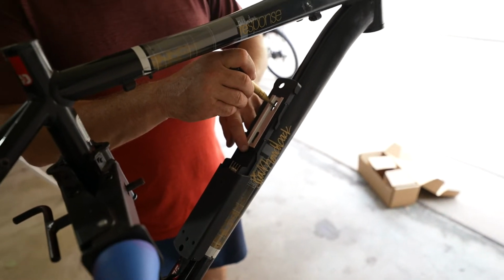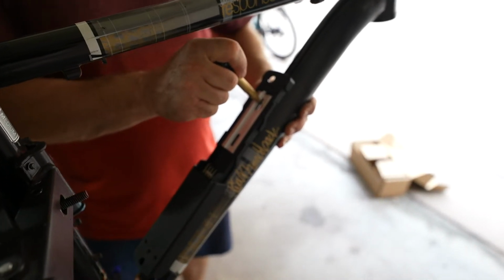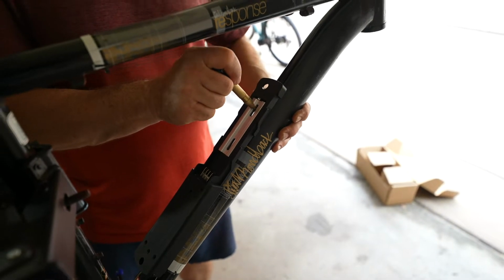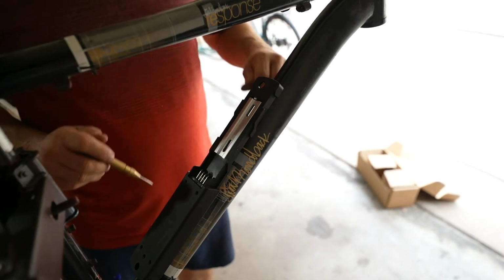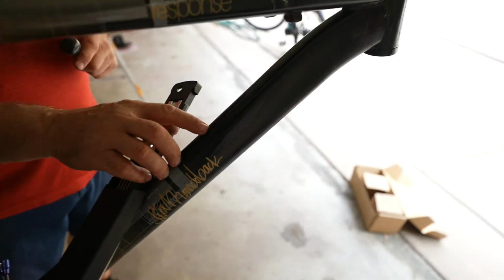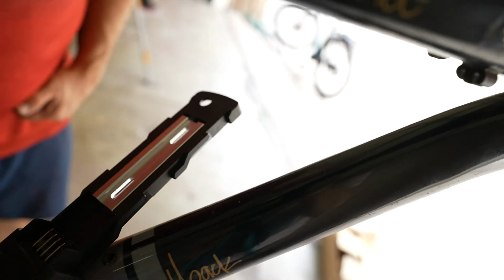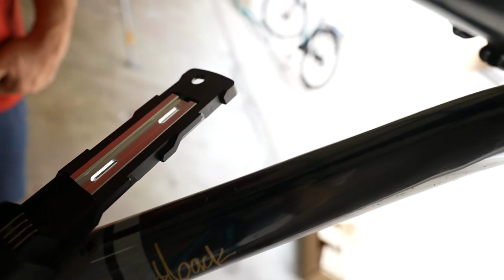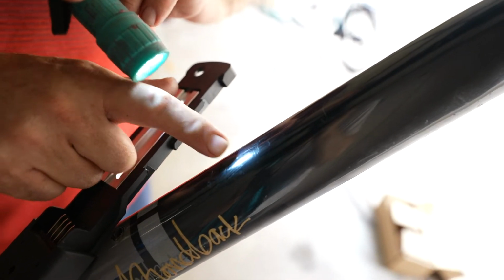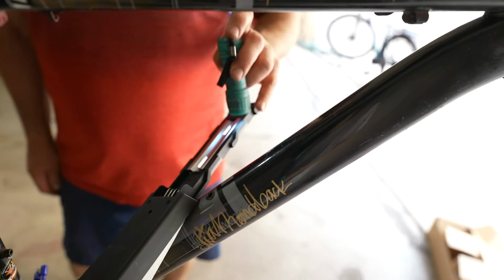So it comes loose. So this tool, you simply press down on it and it makes an indentation. I like to do it a couple times without moving it. And now if we turn this, there's a small mark right here. Perfectly where we would like to place our hole now. It's right there. So now I know where to drill the hole. I can leave this here. I can remove it.